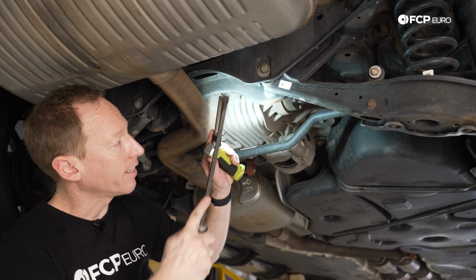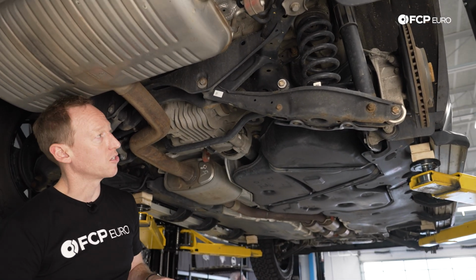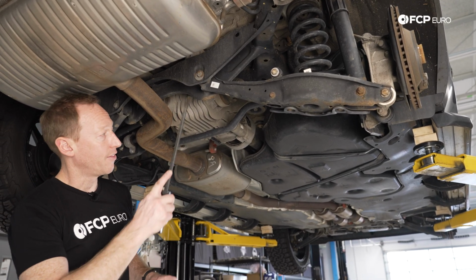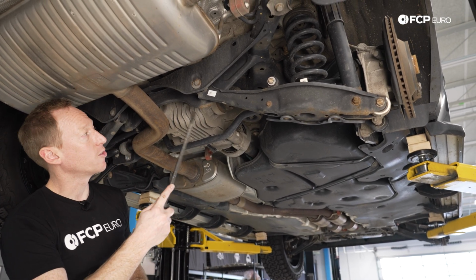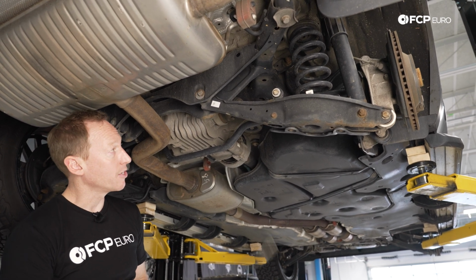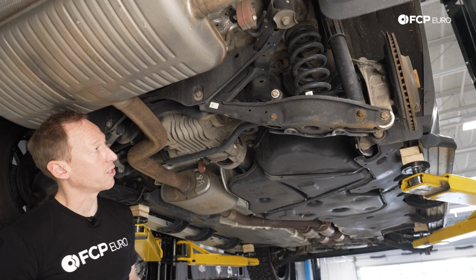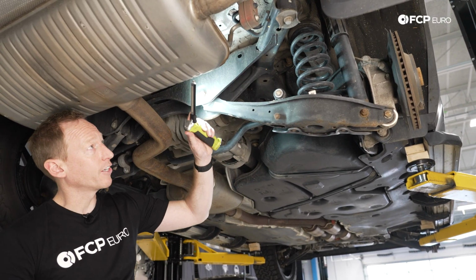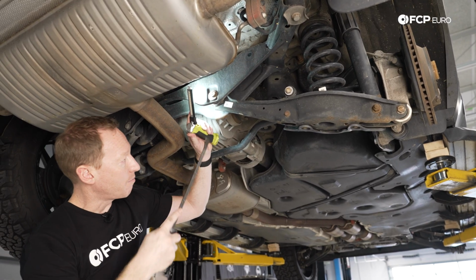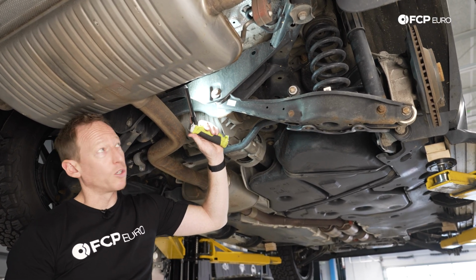Other than that, looking at this vehicle, looking at corrosion, knowing this is a Northeast vehicle that sees a lot of time in the salt, goes to the mountains constantly for snowboarding, things like that, there's virtually almost zero corrosion on here given the age and the mileage of the vehicle. Some of the older Volkswagens, it would not be unusual to see a decent amount of corrosion on this lower subframe. So it's actually really encouraging, thinking about long-term life of this vehicle, the primary body, all the suspension components, like this is designed and built to last for quite a long time.